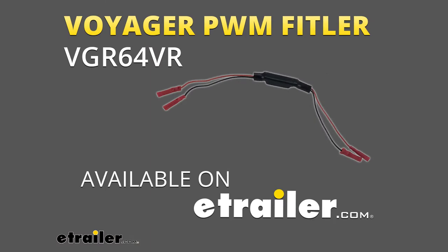The camera, however, cannot operate if it's getting power and then losing it. Every time it loses power it's unable to send a signal, so that constant on and off interrupts it and just makes the camera not work. There are adapters available here at etrailer that store that voltage to provide a constant 12 volts, so the camera is able to operate — it's a pretty easy inline component to install.